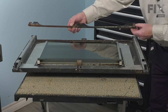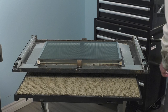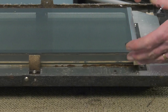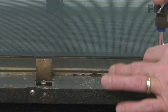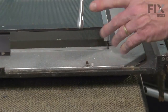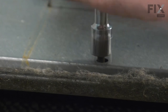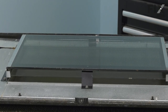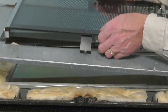This bracket may have stuck to the bottom of the door or may still be attached to the door frame — simply lift that off and set it aside as well. With the outer door panel removed, we've now exposed four studs that secure the inner heat shield and the window pad. We're simply going to take those four three-eighths nuts off of those studs. We can then carefully lift out that window pad and heat shield, as well as the top heat shield, in one movement and set that aside.